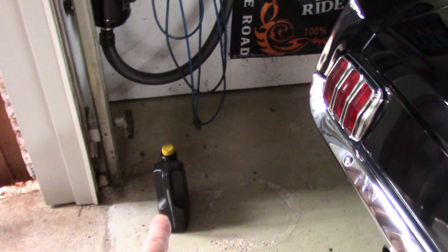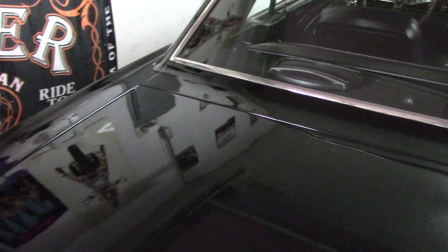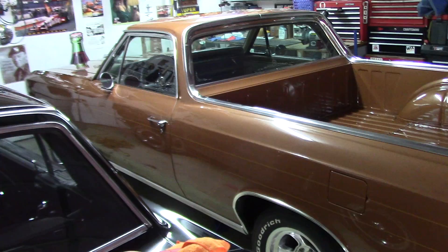If you've been following my channel, I've been using Citral 266 by the gallon, straight, to clean all the little cracks and crevices — around the chrome trim, the jambs, the sills, and around the trunk lid. There was just white compound everywhere. Whoever tried to remove it used sandpaper because it was that aggressive. But Citral 266 on a microfiber towel, just going back and forth over those creases, pulled up that old compound just fine.